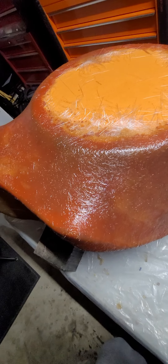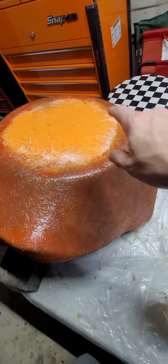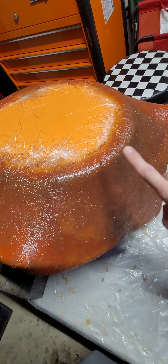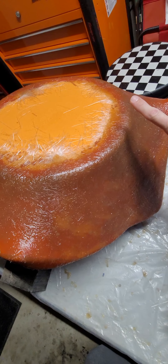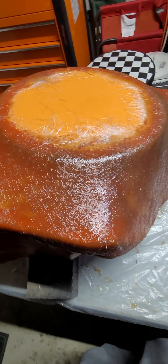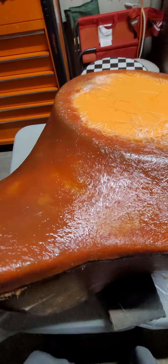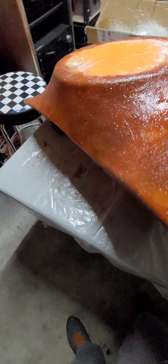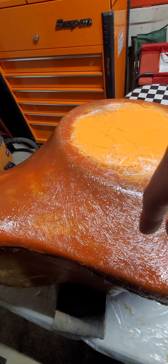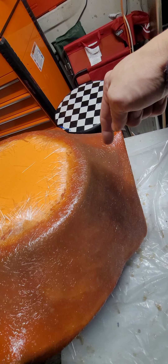That's where we're at. I'm going to let this dry for a little bit. Two 12-ounce batches of resin did this entire face all the way around, plus from here all the way around to where my finger is. I was able to do a second layer of fiberglass matting with two batches of 12 ounces of resin. So 12 ounces of resin goes pretty far if you work it right. I'm going to do a second layer of fiberglass starting where I left off here.